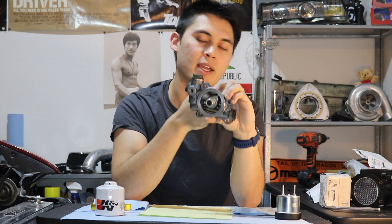When that pressure exceeds that low pressure threshold, the bypass valve opens up. Oil that comes from the sump comes up through this oil filter block, bypasses our filter right here so it doesn't pass through it at all, goes around through some valleys in here, and goes straight back into our engine where unfiltered oil is fed back through. Ideally this bypass valve would never open, because we don't want to see any unfiltered oil passing through our engine, but there are actually three quite common scenarios where we utilize this bypass valve.